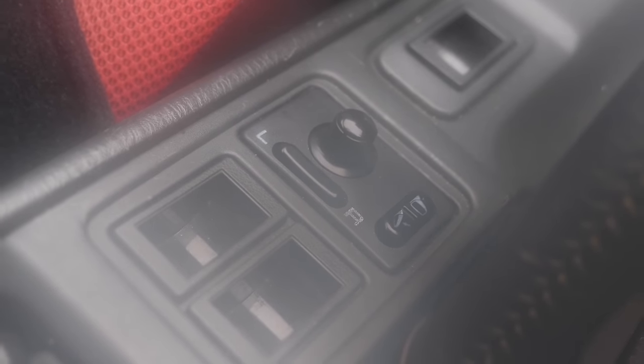And it's quite funny how they decided to put the side mirror controls right in the center console here. They're really strange, a bit like a European car. These are for holding your coins as you go past the toll gates. Maybe not a feature used often. And there's even another one here. On the STI, RA and Type R versions, this is actually the place for the dial for the DCCD electronic differential controller to control the stiffness of the center diff. But this being the normal version, it doesn't actually have the DCCD.